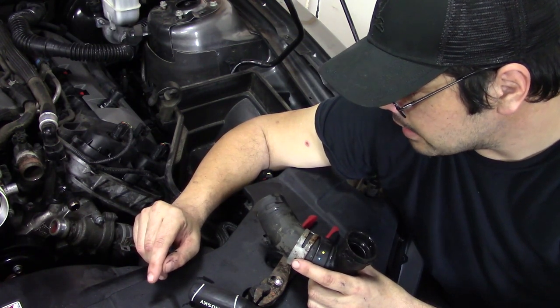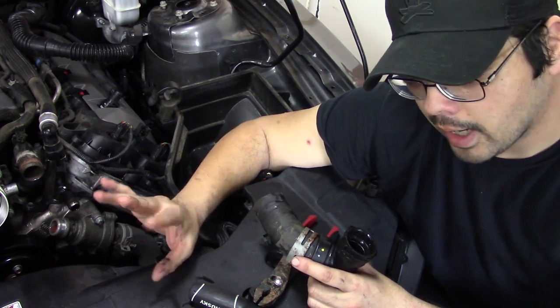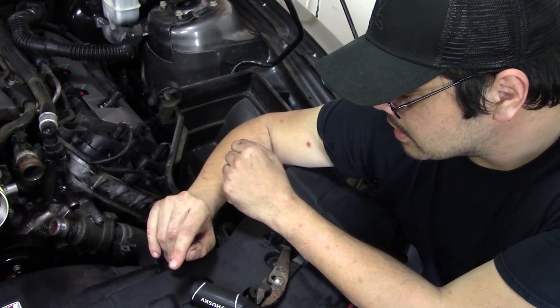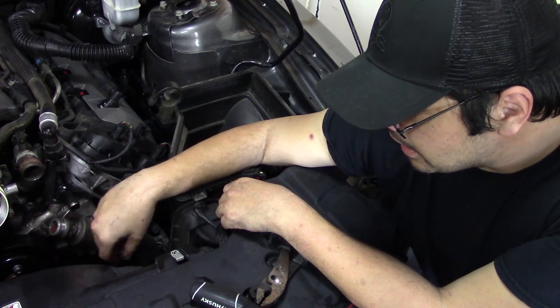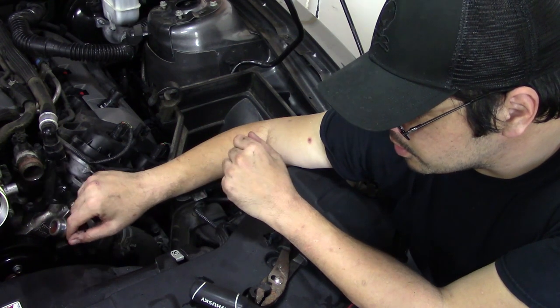And that's a lot of time and mileage for it to be together and running hot, cold, cycling, all that stuff. So I'm probably gonna take the throttle body off just because it will give me more access to the bolts. Don't have to take the fan off, don't have to take the airbox off. Looks like there's only about 10 more bolts that are holding it on, so I'm gonna show you real quick what makes the track pack different from the standard Mustang, and then we'll continue on.